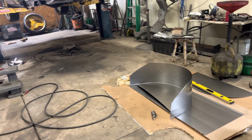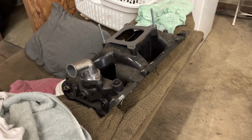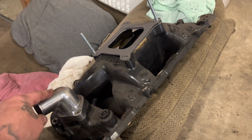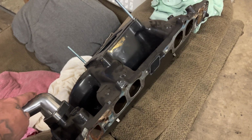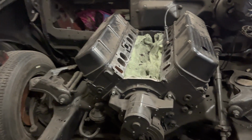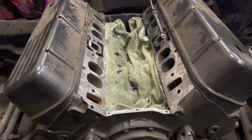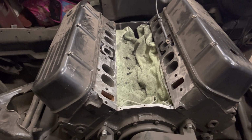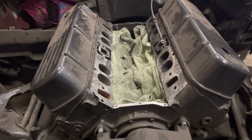But let me step over here real fast. Listen. So we took the air gap intake off my big block. I had the kid do it, he wanted to do it. So anyways, oval port, obviously it's matched up. These runners and all that stuff were ported, match ported. It's got some big valves in the head, stuff like that.